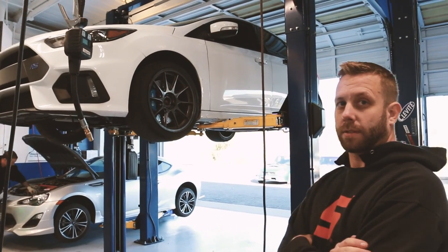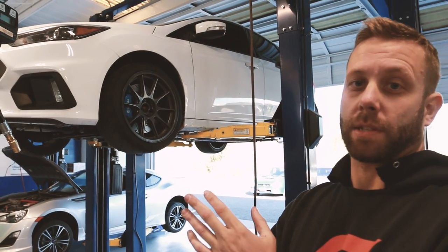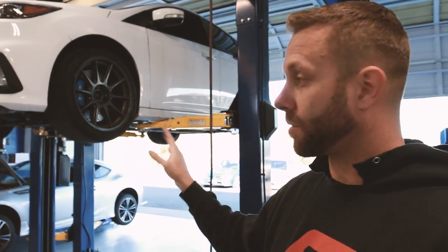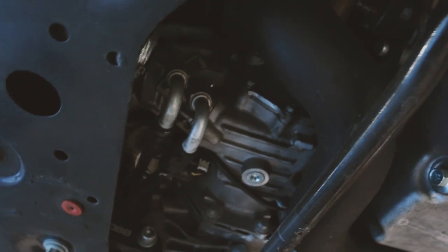The main reason we're here today is to talk about the Ford Focus RS and the all-wheel drive system. I get a lot of people asking about why we dyno the car in two-wheel drive mode and how the all-wheel drive works, because it is a lot different from just about everything out here — especially Subarus and Audis. Torque comes out of the motor through the transmission and goes through this right here — it's called a PTU, Power Transfer Unit — and that transfers the torque back to the rear wheels via a big three-piece drive shaft going all the way back to the RDU, Rear Drive Unit.